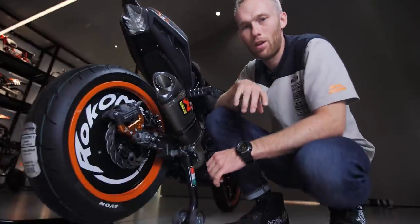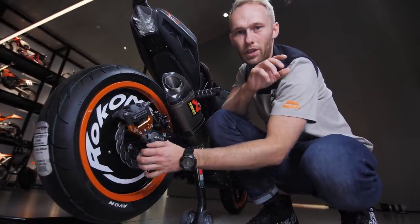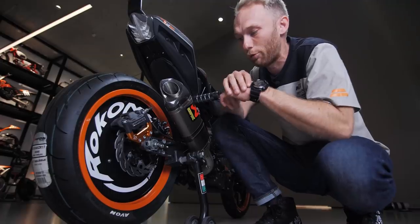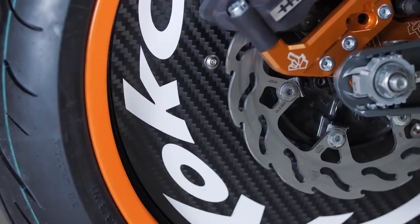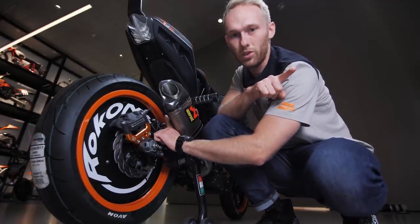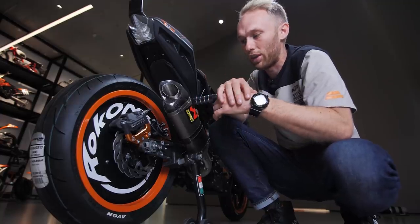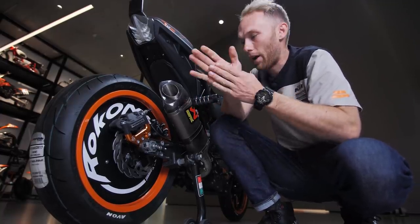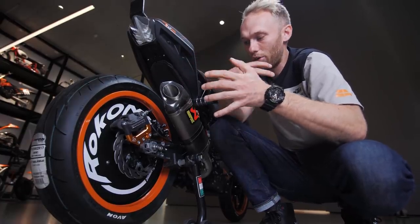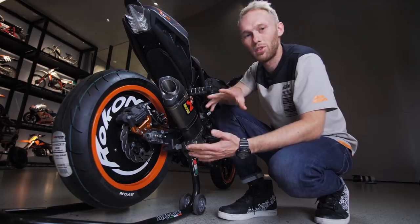Since we're already here, let's continue to the brake setup. For the next season we changed the brake setup. In the past I had a very big 280mm disc; we went back to the stock size and added a racing brake disc from MotoMaster, which works perfectly under high heat and stress. We also added another brake caliper — same as before, but now using a stock foot brake caliper — making the whole braking much smoother and less aggressive on slow tricks. We're using sintered brake pads in both calipers, giving enough bite when needed without being too aggressive with the smaller disc.